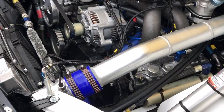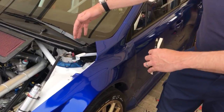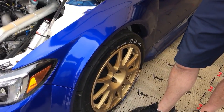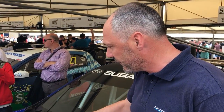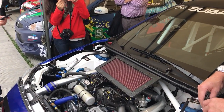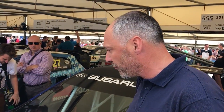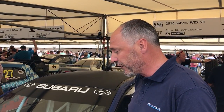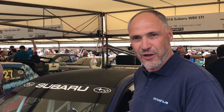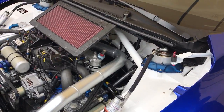One of the big differences from the TT in 2016 to now is a dry sump tank. We've got these big wide slick tires - much wider than a rally tire - and that generated a lot of lateral G in corners, which gave the wet sump system a real headache. We fitted a dry sump system running at around 4.5 bar all the time, which really protects the bearings, the crankshaft, and the spray bars on the pistons. When we finished the TT in 2016, the engine had done about 600 kilometres and was predominantly worn out - we had to throw the crankshaft in the bin, the bearings and cams had worn out. So we redesigned the crankshaft, con rods, and pistons for this year and instigated the dry sump system.